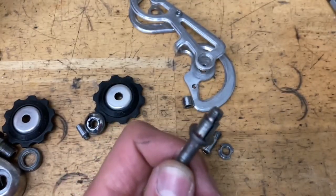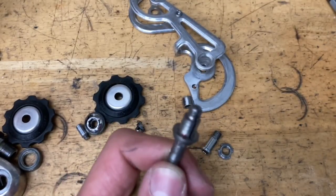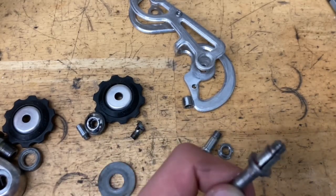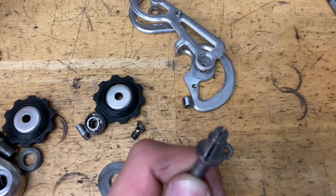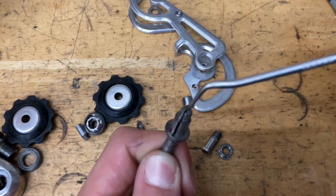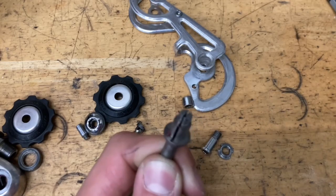The order in which you take off the bolt and the pulley really doesn't matter — I just find it easier that way so the bolt doesn't move around. Also, when trying to take off the spring, a helpful tip: put a pick right in between the slot to kind of open it up if you want to get the spring out easier.